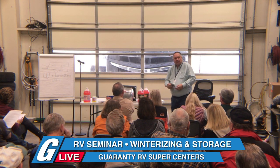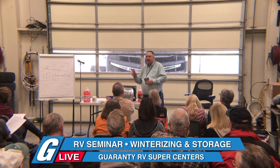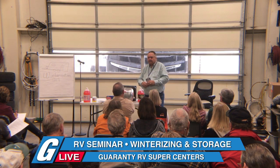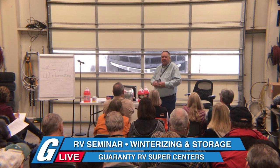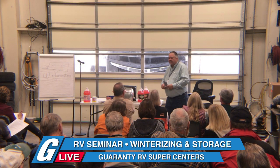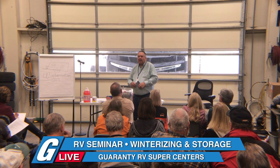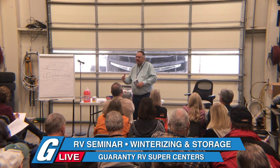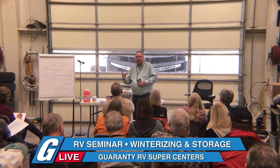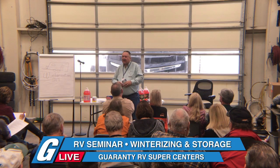Back to where I wanted to talk, there are two different ways to winterize a coach. One is blow the lines out, two is pump antifreeze through. For around here, blowing the lines out is more than satisfactory, as long as you have a compressor that can deliver a high amount of air. We have found that the correct way to blow the lines out is to have a compressor that can deliver a fairly steady 60 to 80 PSI.